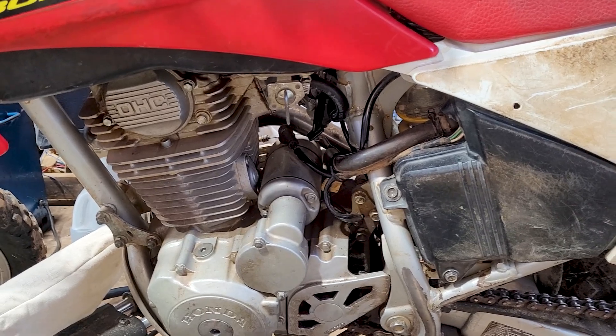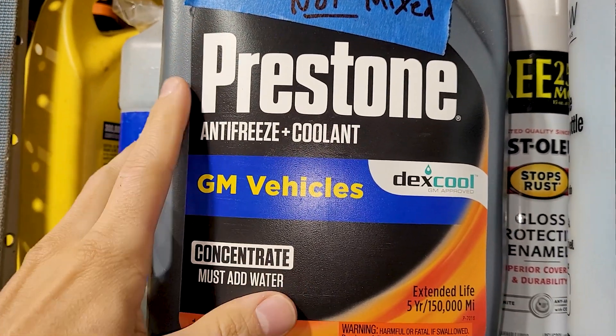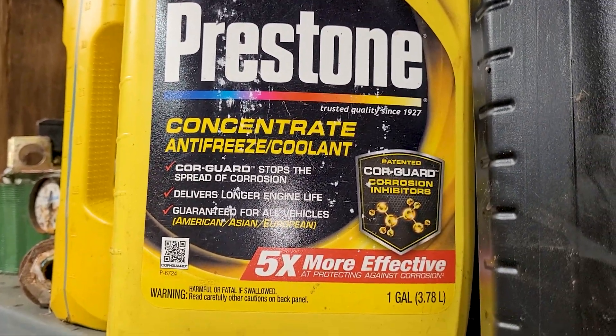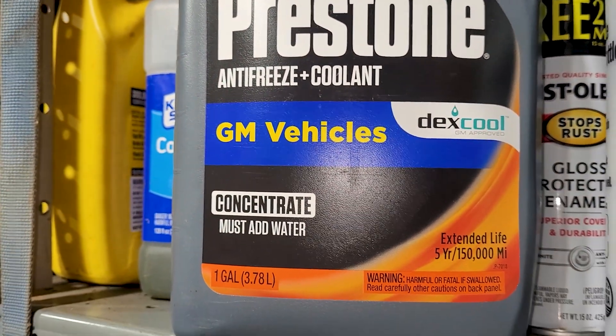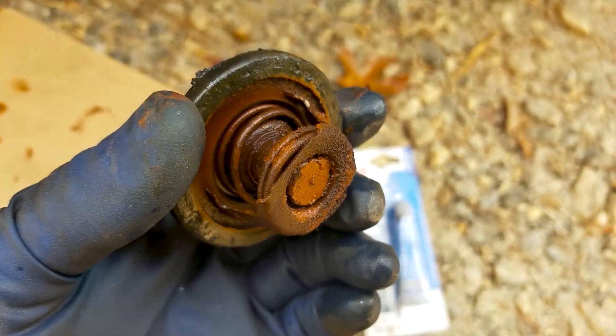Maybe there's an additive, maybe there's something we can do. Here's a real solution: we're just going to switch to air-cooled engines and not worry about all that water and mess — get old-school air-cooled engines and not deal with nasty antifreeze. This right here is what I use in the GM trucks — orange Prestone, five years, 150,000 miles, and I know I'm not exceeding that. And this is what I get for green — Prestone, the best stuff I can get. But it's still rusting. This is concentrate; I mix it 50-50 and label it once it's done — cheaper that way. Maybe there's some additive you dump in here. As far as I know, you're supposed to mix 50-50, dump it in, and it's supposed to work. But it's not doing the job. Maybe it's just these old, neglected engines I'm working on, but I'm sure other people have had this problem too.